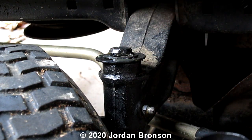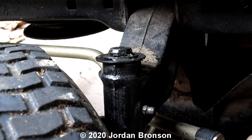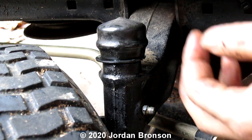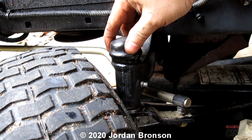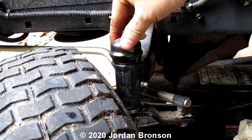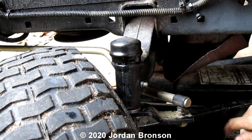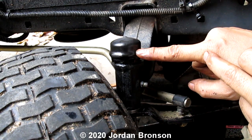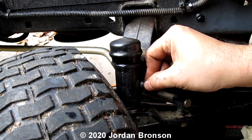We're going to heat this up. And we're going to put it back on. Okay? When it's malleable. Just like that. I'm going to pause the video because I want to heat it up first and then I'll put it back on. Okay, so I melted a little bit just like I did in the beginning. And when it's malleable, just push it down and it's all set. So now it's back to where it is. Just make sure to stay away further out, okay? It's about 3 inches. That's my suggestion. You just want to heat it up just a little bit so it won't burn, because remember, you got grease in here. And then now we're going to grease this up.